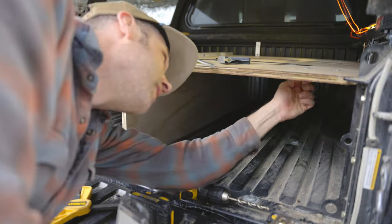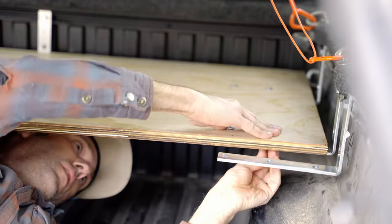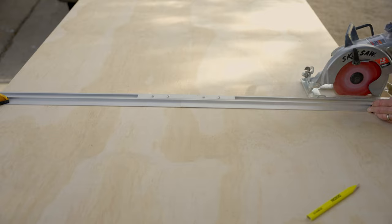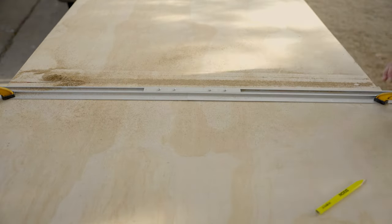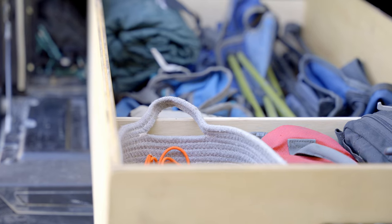So what makes it lightweight? It's the construction technique that I used. I used as little plywood as possible. The top plate ties into the rails on the side of the bed, the factory T-slot rails. Instead of using plywood uprights and a plywood bottom, it just has a top and one single support in the middle. The top is three-quarter inch plywood with a simple cheap indoor-outdoor carpet on top.